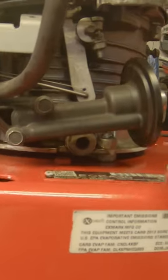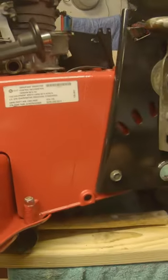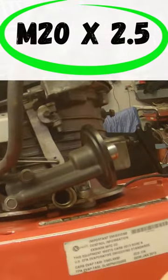You can do this without taking the oil filter adapter off. Just go ahead and pull that out — I've got the oil drain plug out and I've got this mower tilted up. When you change these on Kawasaki engines, they have a pretty unique plug — it's not a pipe thread or anything like that.